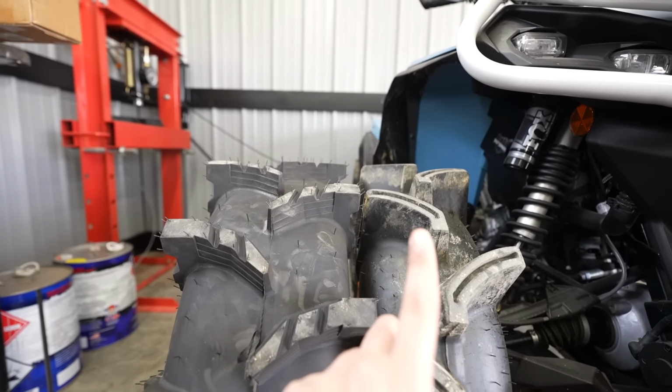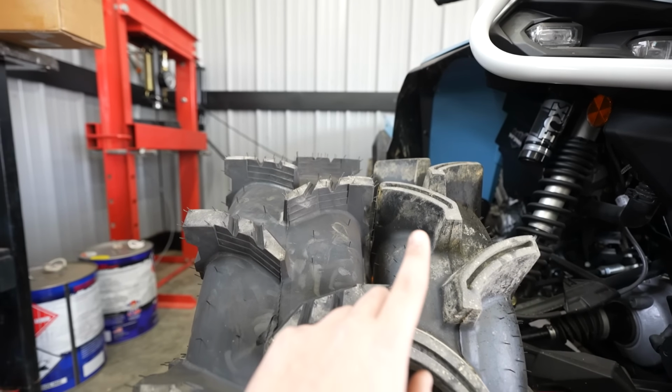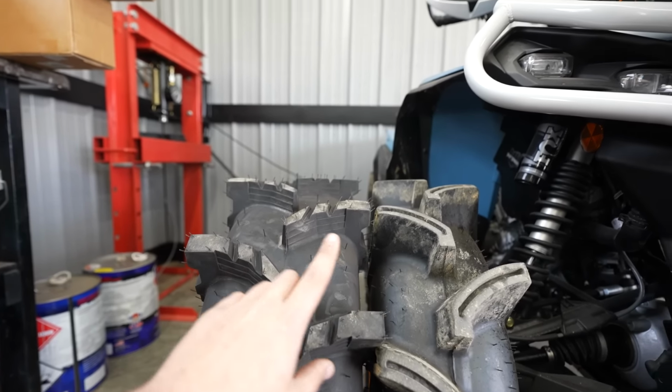If you look at the tires side by side, especially up here at the top, you can definitely notice this 10 wide is a lot wider than the 9 wide. Now, what I think is going to happen, I think the Nators are going to be better in typical mud, your clay, your gunk, your goop. But I think these Outlaw Maxes are going to be better at places like Busco, where there's a lot of sand. Them being wider, having more flotation, a little bit smaller knobbies where it's not going to dig straight to the bottom. I think we're going to see a big improvement there.